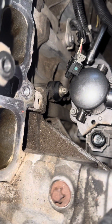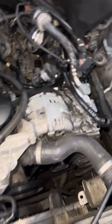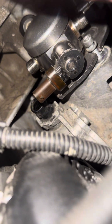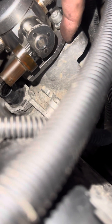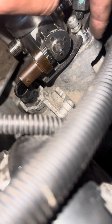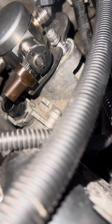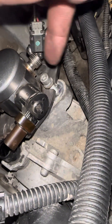Basically the pump is done — it looks like I did it and it's good. One thing you do want to make sure is that it's flat when you're done tightening. You want to make sure that this is making contact with the vacuum pump and same on the other side — it has to be flat all around. If it's not you're going to have issues. Make sure it's seating all the way in and make sure you don't have tension like I do here — as you can see it's a little crooked, so we just have to cut a little bit more.